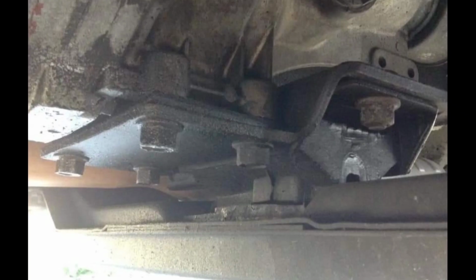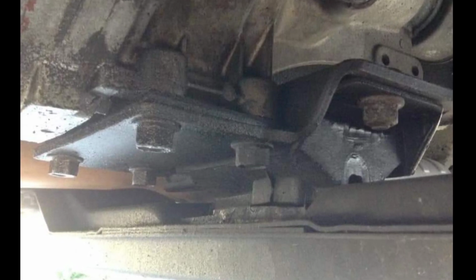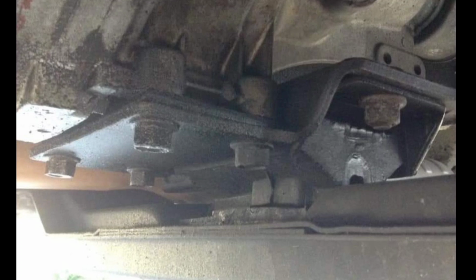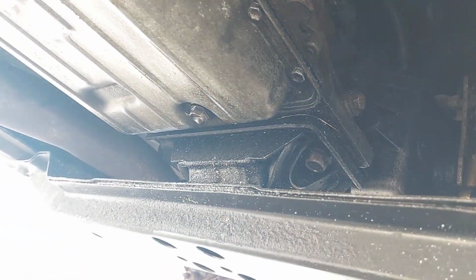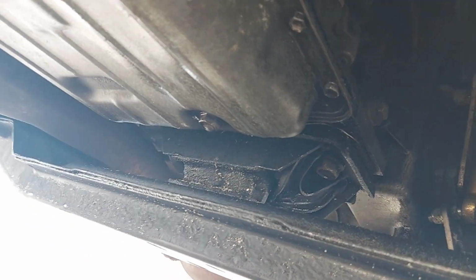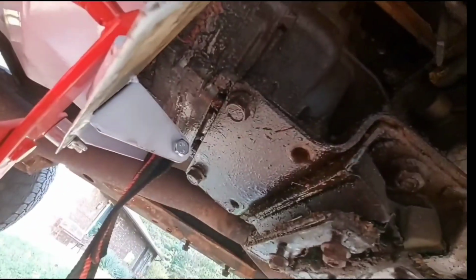I should also mention that yes, despite how hard it is to find one of these, you do need it, because either manual transmission is a good length shorter than the AW4. You can see the AW4 doesn't need this bracket because the mount attaches directly to the transmission, but the shorter case length of the manuals means they need this extension to attach to the crossmember.